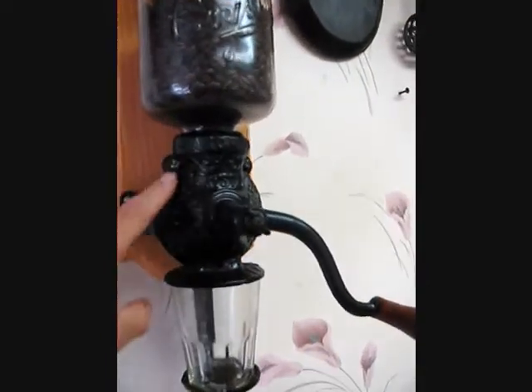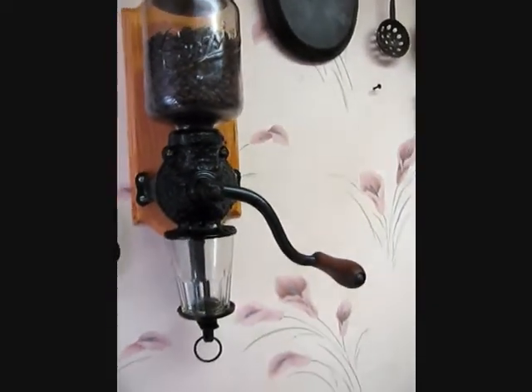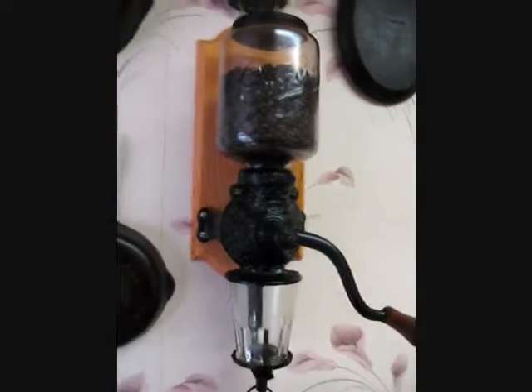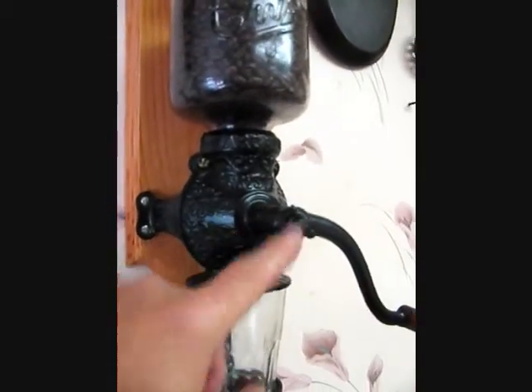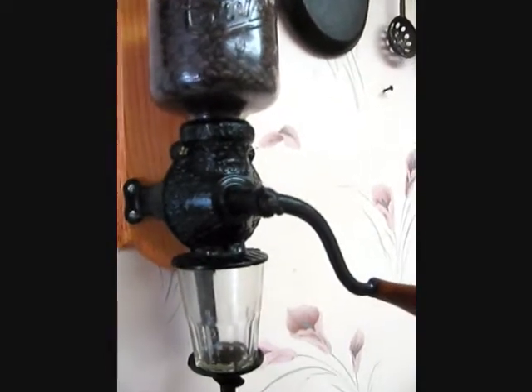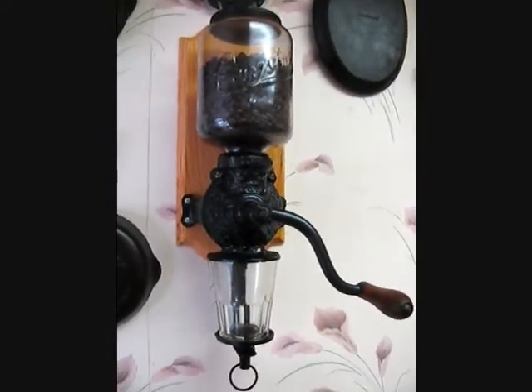The grinders meet to make a finer grind, and if there's something in there, it's going to prevent this knob from tightening. So I took the entire unit apart, and sure enough there were whole beans in the mechanism. I cleared everything out, put it back, and then I was able to turn the adjustment knob much, much further to the right. As I put the beans in and cranked it, I got an extremely fine espresso-style grind.